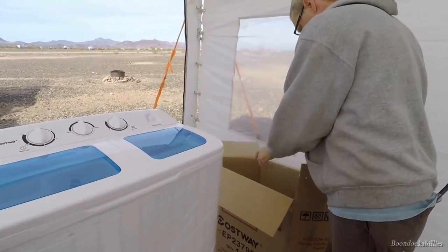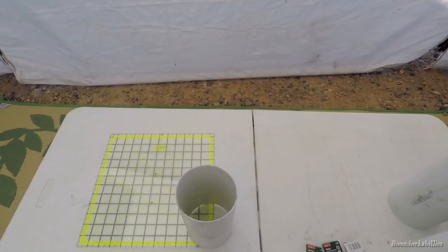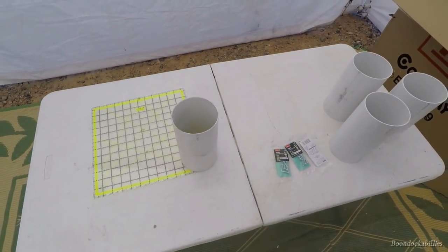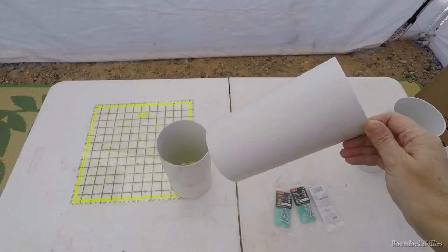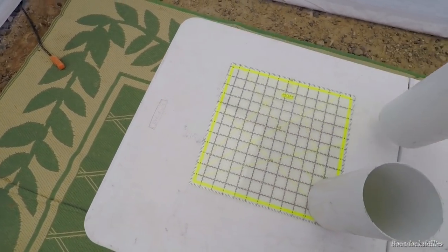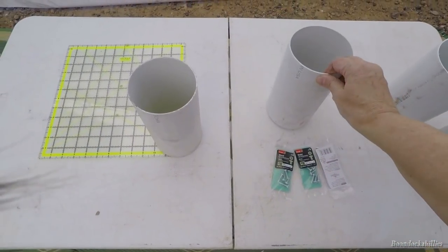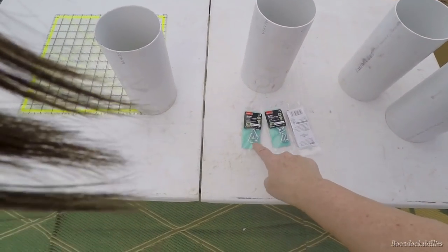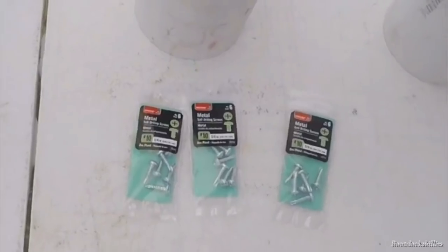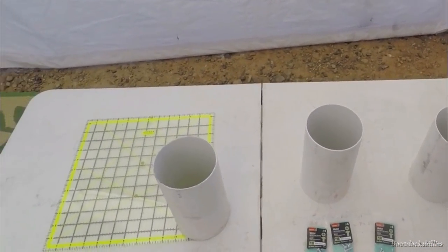These machines are very short and for tall people like us it's difficult. We may get some little legs again. I wanted to show you what the legs look like — it's just PVC pipe chopped up into four segments, about eight inches long and four inches wide. They just pop right up over the legs of the wash machine and get attached with a couple of self-tapping screws. That holds everything up and out of the water and makes it easier to reach.